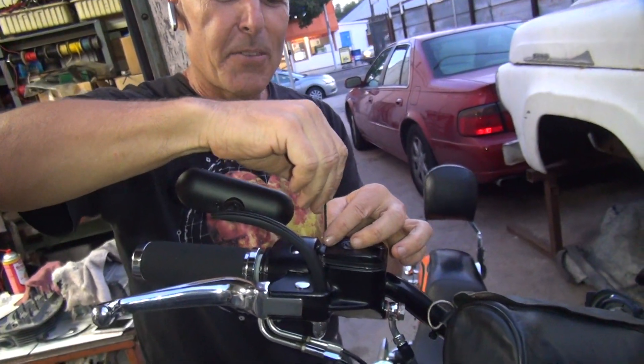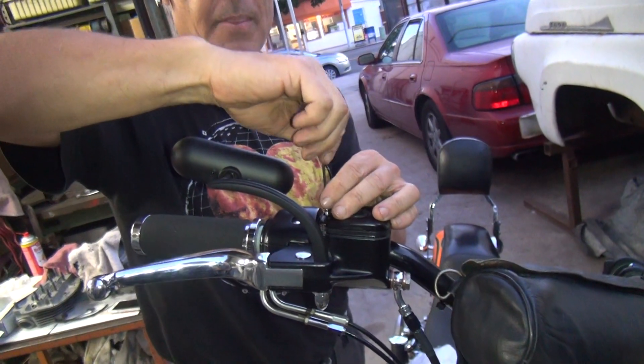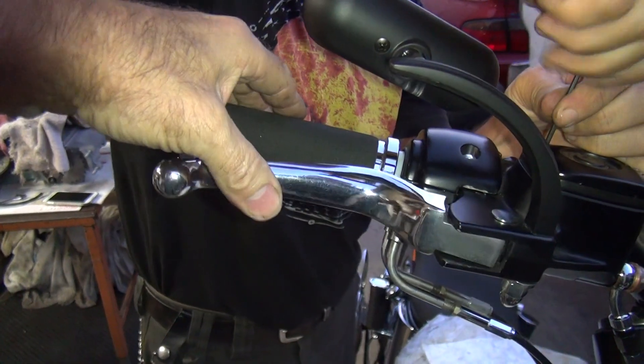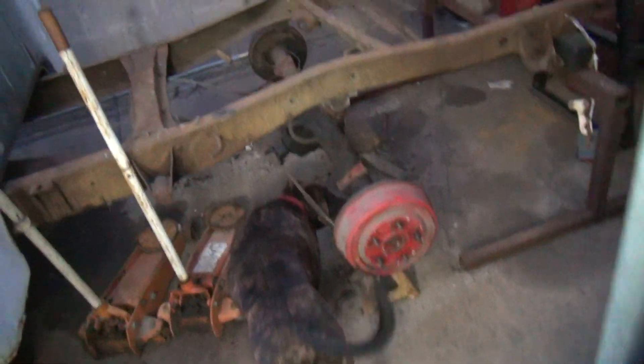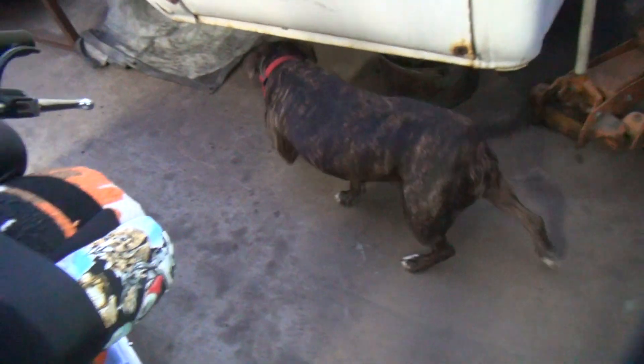Recap for the audience: when we went to break, the lever was all the way to the grip with no brakes — pump it up and brakes come back, but there were traces of fluid around the banjo washers. Every time it happened, it was in the same spot, so it must be leaking. There was fluid on the face and on the gas tank while riding.